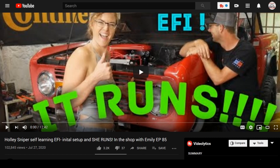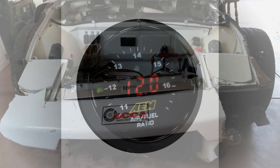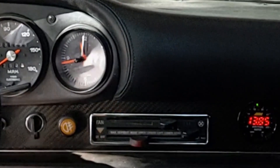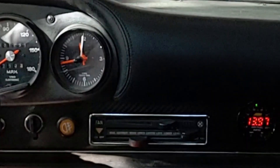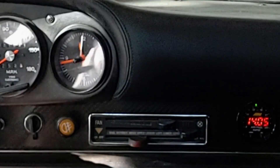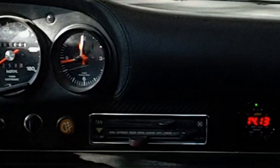So what did I do? When we bought the LS914 with its wrecked front end, it was a running and driving car — it just looked a bit sketchy. One of the first things I did after fixing the body was to install an AEM wideband. This told me the tune was close but a bit on the lean side, so I decided to try the low-buck option and see if I could turn up the rev limit and add some more fuel. I purchased a couple of extra P01 LS computers and gave ECU hacking a try. I already had the OBD-Link MX scan tool, so it was just a matter of making a bench cable and getting the free apps and software.